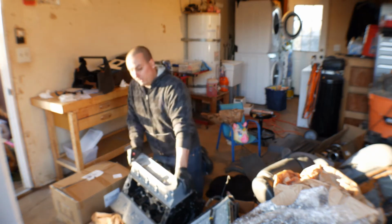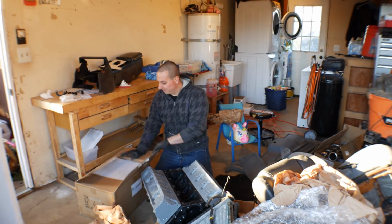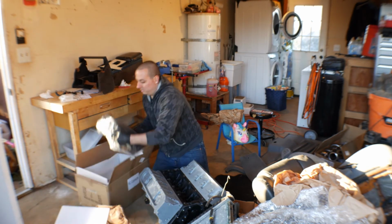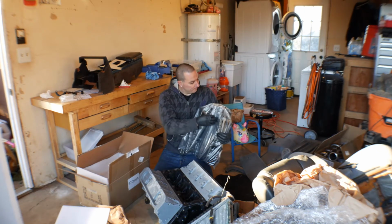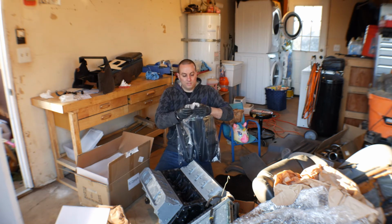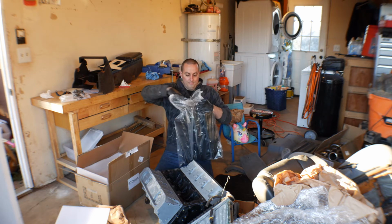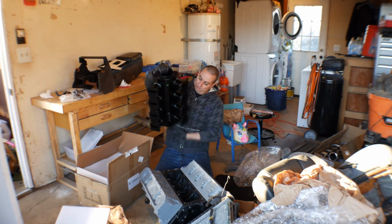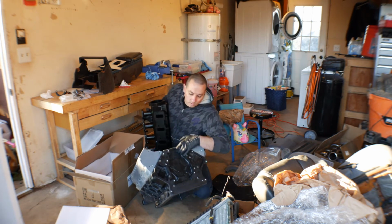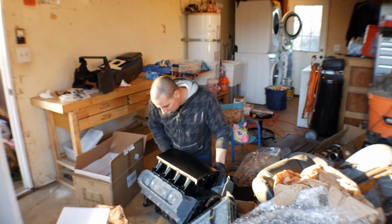And then if we continue our unboxing extravaganza, I've already cut it, but we also have this. So this is a 6061 all TIG welded 1/8 inch aluminum intake manifold, and this is going to hold 30 pounds of boost. So this should be able to hold for what we're going to use it for. And when we put this on the Mockup block, we should be able to get it lined up and actually try this intake like that.